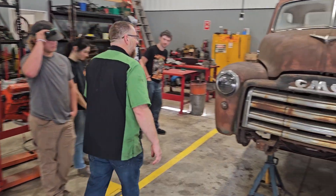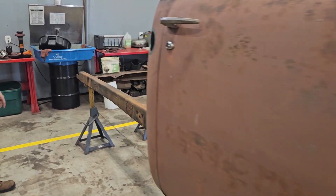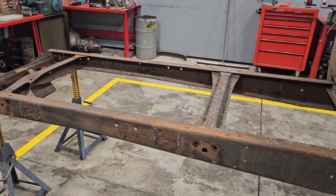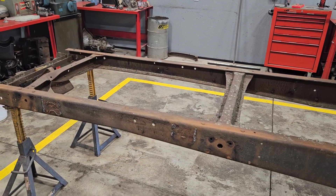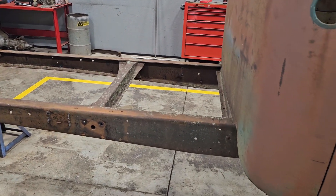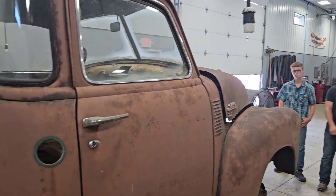We'll kind of walk around the truck a little bit. We're trying to strip it down to the frame — we've got the whole back half gone. We've got the spring, the brackets, the differential — all that stuff is out. You guys made pretty quick time of this. You guys just got this, what, Tuesday? Yeah, we started Tuesday night at 6 o'clock, and in two hours we had this down to the frame. The goal for next Tuesday night is to get the cab off and get the front end off, and maybe start setting the frame up to get ready to front clip it.